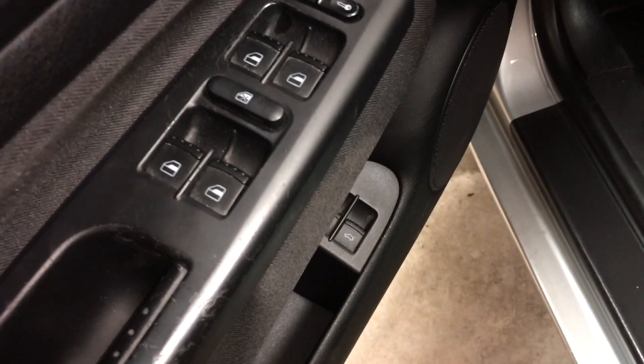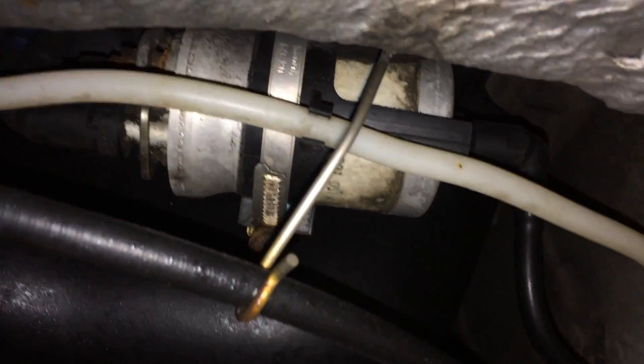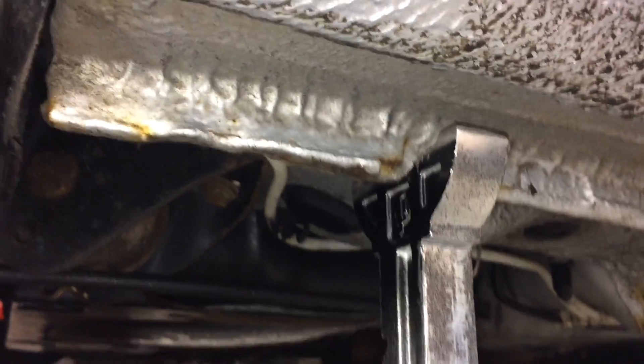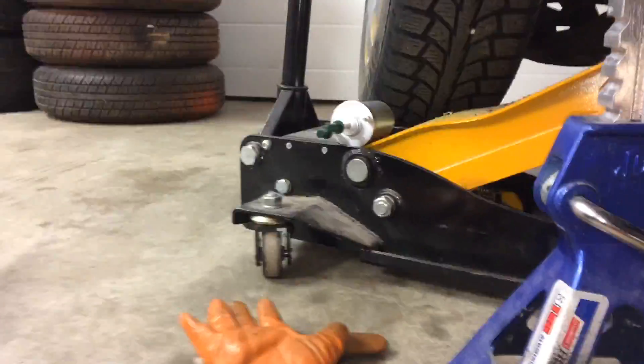A good idea to open up the gas cap and relieve all the pressure. The fuel filter is located at the rear passenger side of the vehicle — just right there. Go ahead and jack up the vehicle under one of these points here, and then put a jack stand under the reinforced part of the pinch weld, which is roughly around here. Then we can take the fuel filter off. Here's a quick look at the old filter, just under the car.